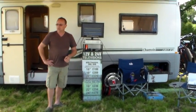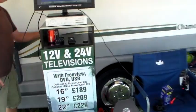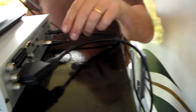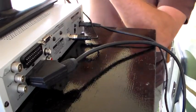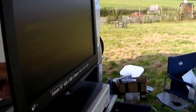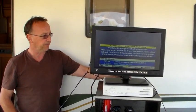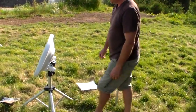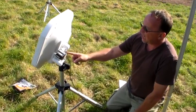The connections for the Skybox are as follows. We have an F-type connector going into the dish input. We have our 3.5mm jack going to the headphone output of the television, and of course we've got our cable connecting the television to the Skybox, which could be either a SCART or an HDMI lead. Then the cable is connected to the dish, and connecting it to the dish we connect the other side of the F-type connector to the actual LNB.